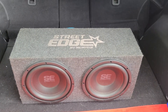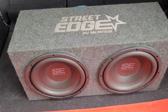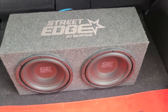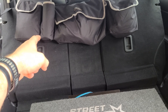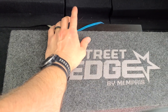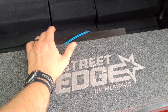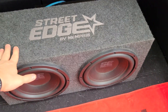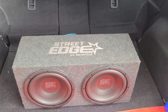Check out the links in the description for a more detailed review of this install. If you don't want your subwoofers moving around, you can use L brackets to mount them in place. To recap the basics: run power from the battery down the side of the car, ground to the chassis, use the remote turn-on wire, and get your audio signal via RCA cables either from the head unit or by using a line output converter tapping the rear speakers. Once those are all connected, that's really all there is to it. Drop any questions in the comments below!